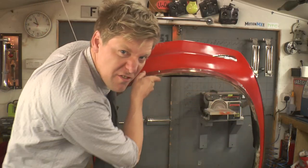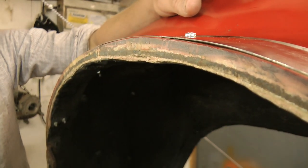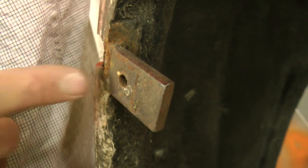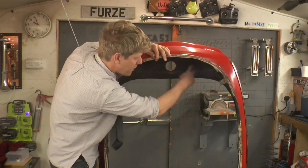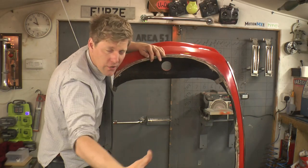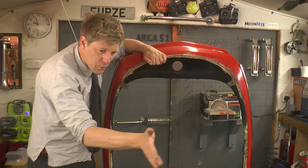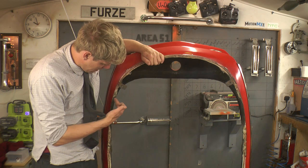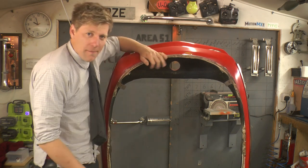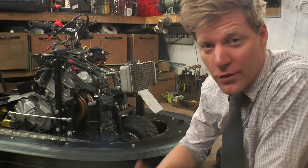Now the tub - you didn't really see much of this. We were quite lucky: there's like a metal ring which runs all the way around the base of it, and we could cut into that and weld our tags onto it to fix it down onto the frame. We also used that for the earth for the lights - all the lights got wired up and we just put a bolt through that little bit of metal, and when that bolts back onto the chassis it connects the earth up. The only thing we had to do was cut a little bit out in the corners, because the wheels are as far apart as we could possibly get them, so we had to shave a little bit out - we had to cut that metal ring there, but that didn't matter. And the front steering system? Absolutely fantastic, would not change that at all - spot on.